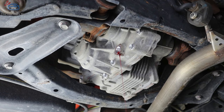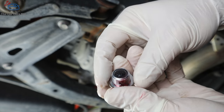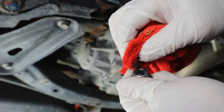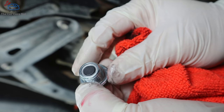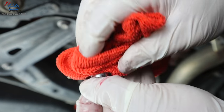While we wait for this to finish draining, I want to bring your attention to one thing. On the transmission, both the fill plug and drain plug are the exact same plug, but on the differential the drain plug will have a magnet — and you can see this one has a little bit of sediment on it. Before you install it, take a shop towel and clean it up really well. Here's how the final result should look: the magnet right in the middle of the drain plug, nice and clean. You can use a little brake cleaner if you want, but if you're working indoors be careful.